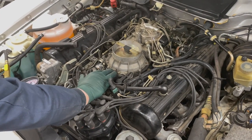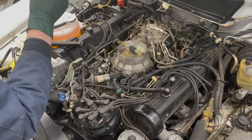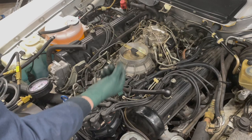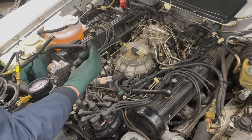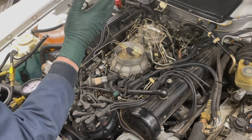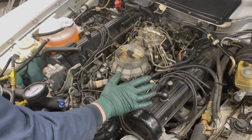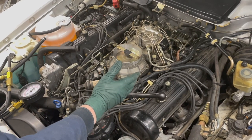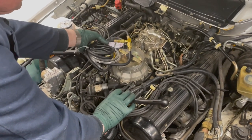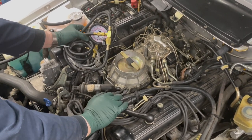I have to admit that was a lot easier than I thought. Hooking the fuel pumps up directly from the battery was easier than going through the process of removing the glove box and pulling those relays out, or removing the kick panel and trying to get to that suggested X-18 plug that the factory recommended. But look at this — now I've got fuel pressure on demand. I don't have to turn the key. I don't have to activate anything electrically inside the engine compartment. So this is great for safety. And now I'm ready to hook up my fuel pressure tester and go through the whole sequence of testing this KE Jetronic fuel system.